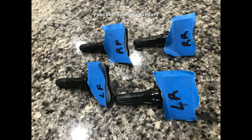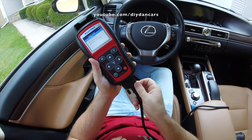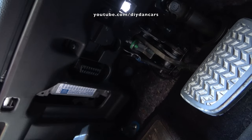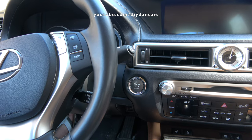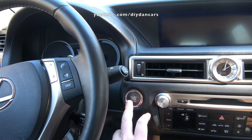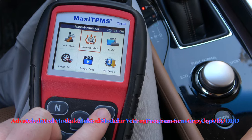Now let me show you how to retrieve the unique sensor IDs from a dead tire pressure sensor. If your sensors are dead, then the only way to clone them will be to download the sensor's unique IDs from the car's computer. You can also use this method even if your sensors are good — it just saves you from having to walk around the car. To do this, you'll need to connect the tool to the car's OBD port, which will allow the tool to communicate with the car's computer. For most vehicles, the OBD port is located under the steering column. I put the car into accessory mode by leaving my foot off the brake and pressing the start button twice, which turns the car on without having the engine running.